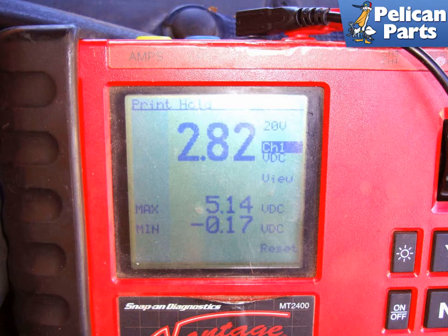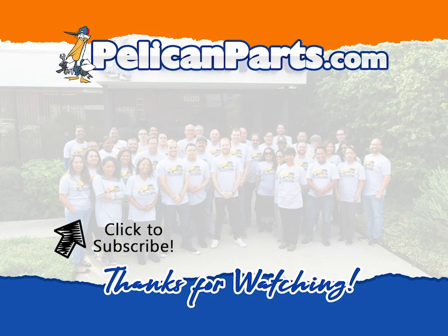The problem these modules suffer is the 5-volt reference drops out. This may be momentary, so you would have to be watching your meter when it happens or have more sophisticated electrical equipment to capture the drop in voltage. Test the brake switch, and if the brake switch works properly, then you should look into getting your brake module serviced or replaced.